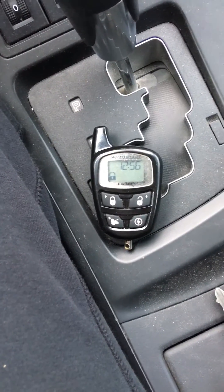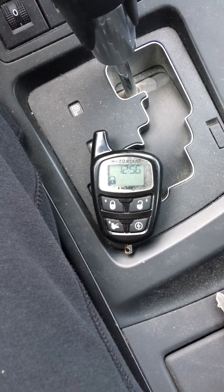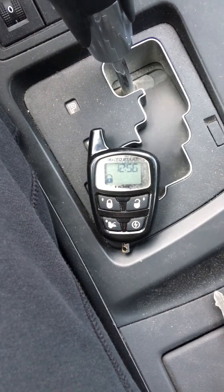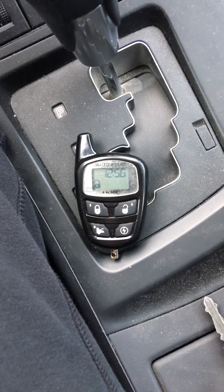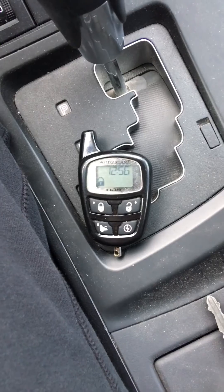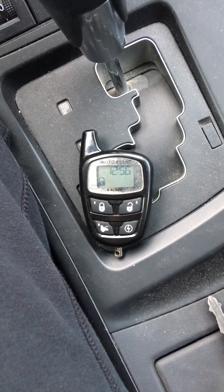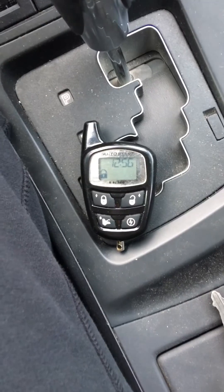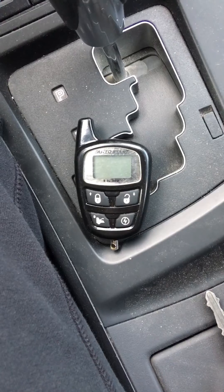Take a clock, look at the clock, count it. Lots of remotes I have worked with, I pressed it, counted quickly, released it, turned the ignition on and off, the light on the antenna came on, pressed the lock button, and nothing happened. I learned that you have to be right on time when programming these types of remotes. You cannot do it too quickly — one, two, three, four, five. You actually have to press for five full seconds, release it, press and release, then turn the ignition on and off, and that will work.